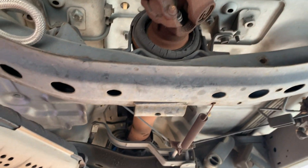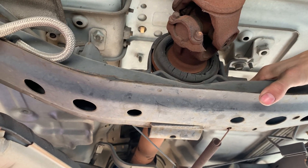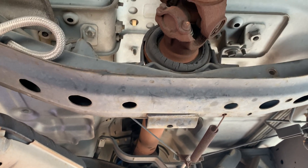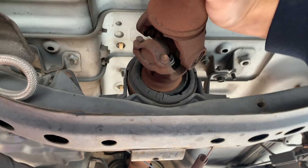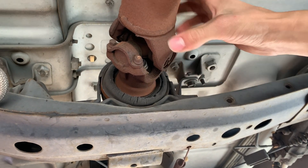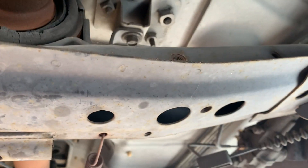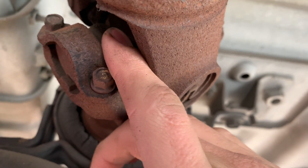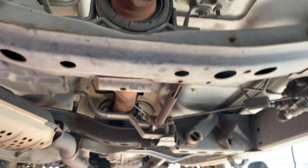The reason I need to do this is because when I let off the gas in my truck and the drivetrain goes under load, this wobbles around and feels mighty rickety. My U-joints are also shot out — I don't think they've been greased ever. The cups are all worn out, so it wouldn't hurt to replace those while I'm taking the driveshaft out.